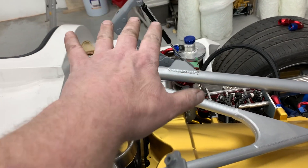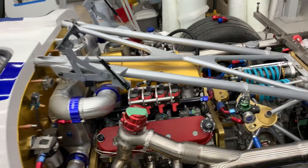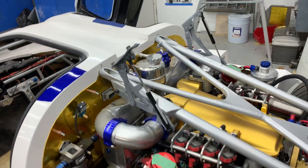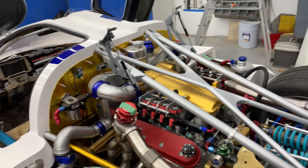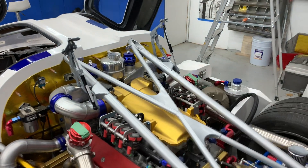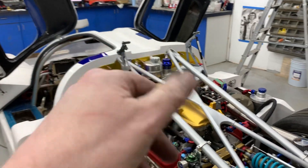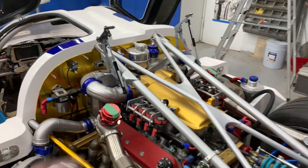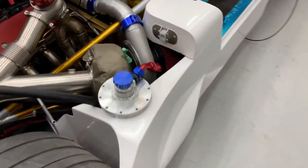I have a mind to put two vents in the top of the rear clip. The current plan is a flap that will open when ground speed is too low to exit air, but once you get any speed up I don't need it as much and I don't want the extra drag — I want to keep the air on the body. So those flaps will automatically close using a PWM signal with a 12-volt servo like you'd see in robots or RC cars. When the ignition is off or powered down, or based on air temperature at the back, they'll open or close depending on the logic — which we still have to work out.